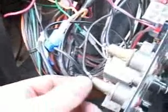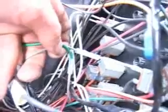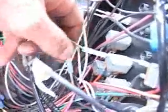An excellent place to connect the orange wire from the child reminder system is onto the indicator light on the panel that carries the signal for the red warning lights being turned on. Simply tap into the feed wire for that, and it'll feed 12 volts to the orange wire when the warning lights have been used.